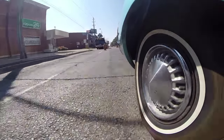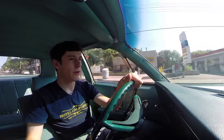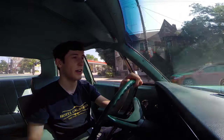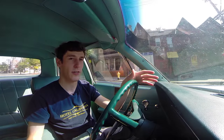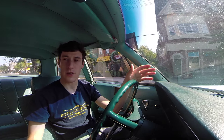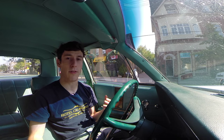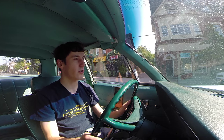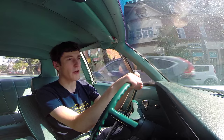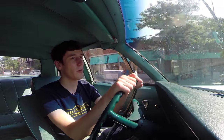This car is pretty much — I'm not going to say original, I've replaced a lot of things — but it's the original specification. I haven't really upgraded anything. We're still using the four drum brakes, which are massive on each side and really cool — finned in the front. I think they're cast iron drums. But they stop you really well once. On the highway you can lock up tires and stop from 60 miles an hour, but they get hot very quickly and are definitely more suited to city driving over highway. I wouldn't want to find their limits on a mountain road. But here in the city, it's not bad — it all works pretty well.